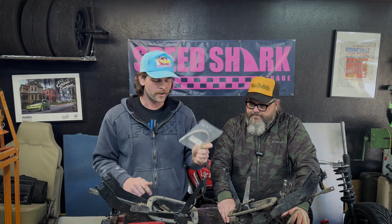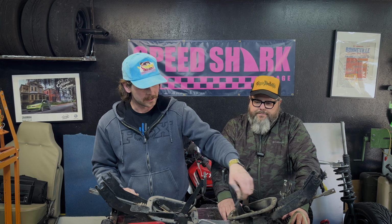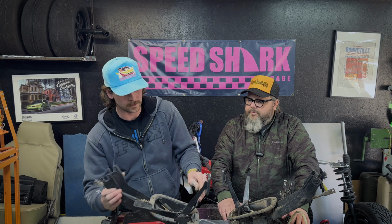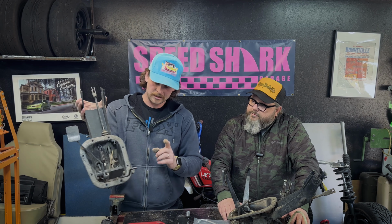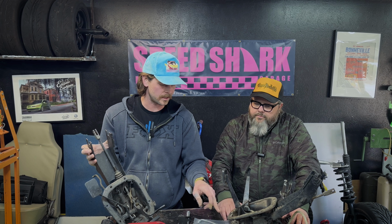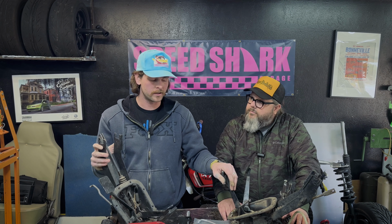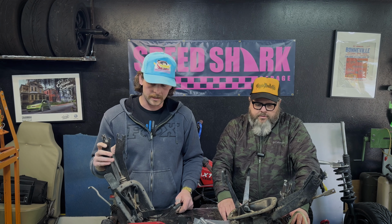There we go. So we're gonna get those, but this one out of the car, the throttle linkage spring is broken, and this one, as you can see, isn't. It's supposed to spring back like that. So Daniel's going to be pulling off this spring and getting this stuff off. We'll probably end up just switching it all over because this one's a little worn out as well. And everything else on here looks good. So we're going to pull it apart. We're going to paint it, clean it, and then put it back together with just some new bushings and bearings. And call it a day.